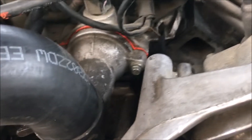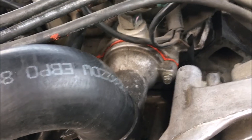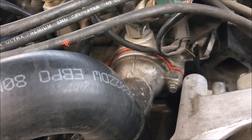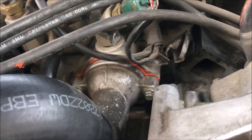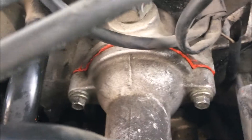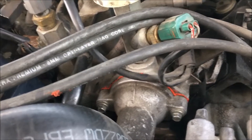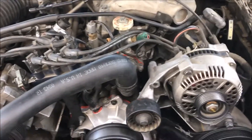Also a good thing to do while you're down there is get the thermostat — just two bolts — and put a lower degree thermostat in there, since the factory puts too high of a thermostat in. Getting from 200 degrees, which the factory thermostat is, all the way to 270 is pretty fast. If you put a 160 or 180 degree thermostat in there, your engine will run consistently cooler, especially on those hot summer days when you have the air conditioning on.